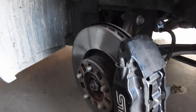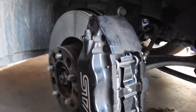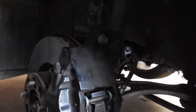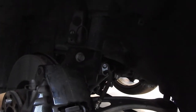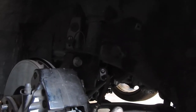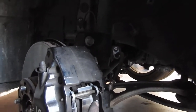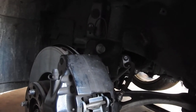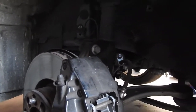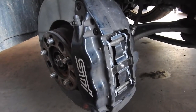These are by far the easiest brakes I've ever done in my whole entire life — Subaru did a nice job. Just take off the pin, remove it all the way, this comes off, and then all you gotta do is compress the pistons — you got two pistons, push both at the same time. Put the new brakes in, put everything back together, and that's it. You don't even need special tools — I used a flat-head screwdriver and that's it.